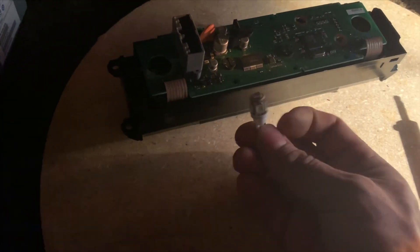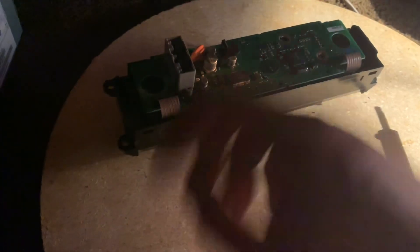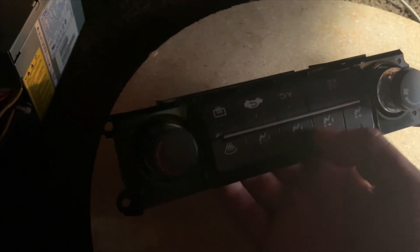You do have to bypass it — I just bypass those two wires so it sends a signal that it's on. It gives me 12 volts, 9 volts, 5 volts, and 3.5 volts, which is pretty neat. I'm going to replicate 12 volts to get my LED turned on. I want to see how it looks before I solder it — some LEDs have a little hue or tint. I know blue is for cold and red is for the heater, so I can put a white one and it'll amplify the colored tint.